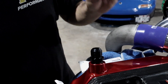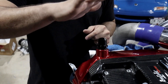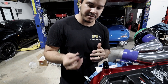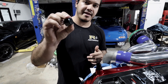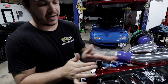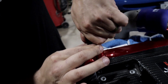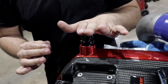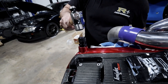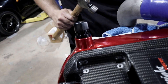Put it in. If you're using a soft blow hammer, you can technically hit on this and it'll go in no problem, and chances are it won't mess up the threads. But if you have a dash-10 cap or an old dash-10 fitting, my recommendation would be to actually thread it on, get it to bottom out and make contact - that's going to protect your threads as you hit it with the hammer. Once you have that set up, you literally just tap it in place.